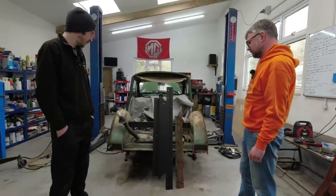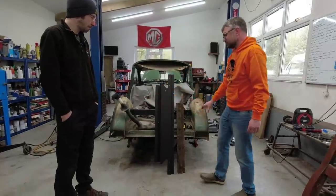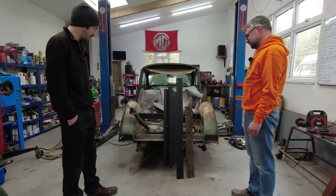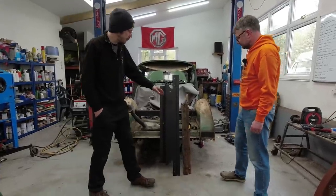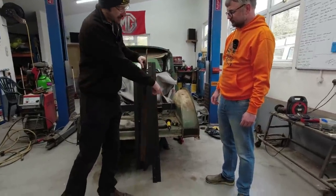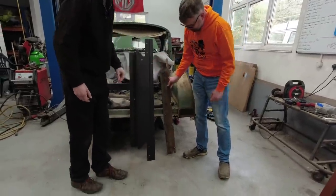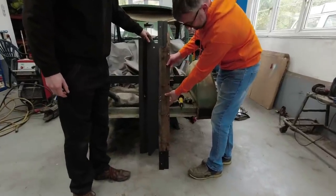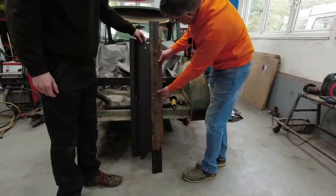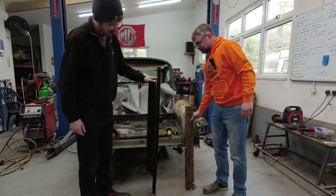The rusty areas are underneath the wooden frame. When we came here last time you'd still got the full rear panel including the wood still to remove. Getting it off involved a lot of rusty bolts, quite a few of which sheared. The main concern was the condition of the rear panel underneath the woodwork - it's all Swiss cheese, nothing left of the ends in a lot of places, so there's no chance of repairing that. For comparison, this is the replacement repair panel - you can see how much is missing from the ends. It's quite a substantial piece with a reinforcement beam in the middle.